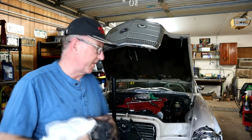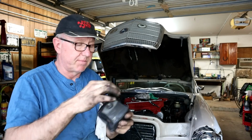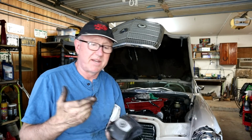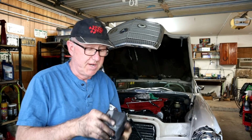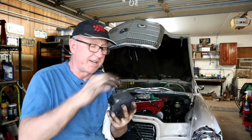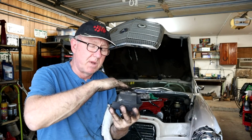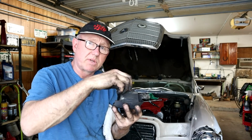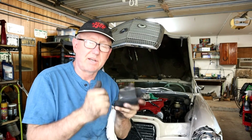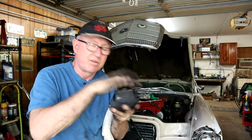I put the engine mount on this side already. Once you position this in and get enough room in there, is when you put the Allen bolts back in there. I put a little bit of anti-seize lubricant, made sure the Allen is really thoroughly cleaned out. I ended up reusing my old ones because they were in great shape. So just make sure they're not damaged in any way. Put a little lubricant on them, and don't cinch them down altogether. I just put them in a couple of turns so that the mount was still movable, and then brought in the heat shield and then the bolt. The subframe's fairly loose, so I was able to move it around, jiggle it, but it took a little bit of a hassle, but you could finally get a couple of turns on the main bolt, cinch that down, and then you can fully tighten these.